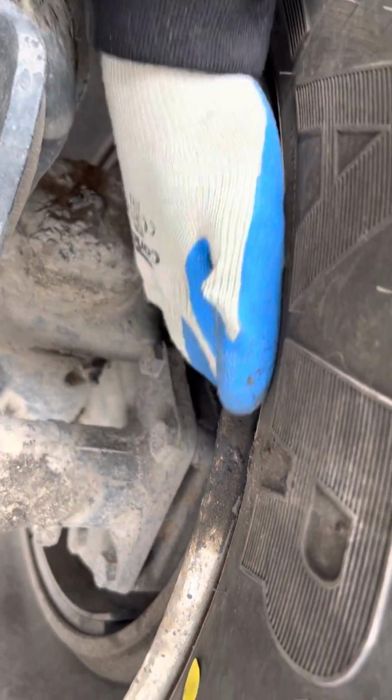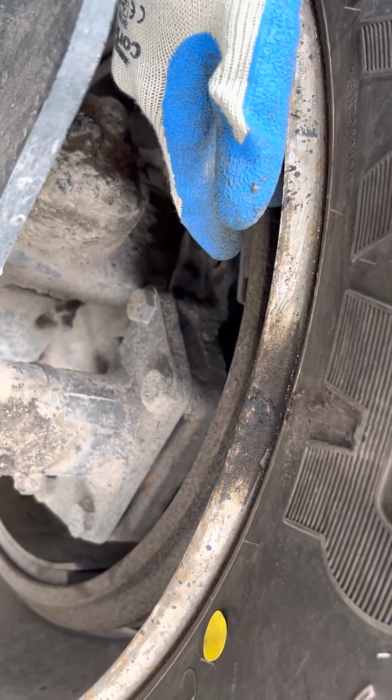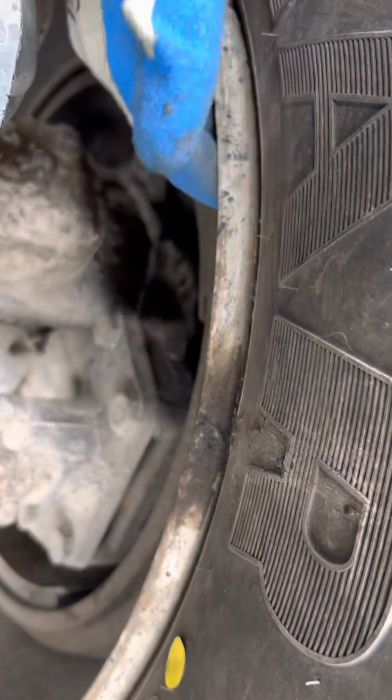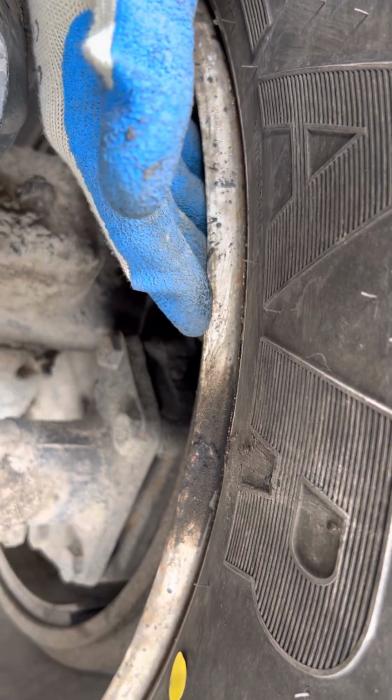Then I have my brake drum on the outside of that. 2 things. Make sure it has no heat stress and no fluid on it either. And make sure it's not bent, broken, or cracked, properly mounted and secure. Then I have my inner rim. Make sure it has no illegal welds, not bent, broken, or cracked, properly mounted and secured.